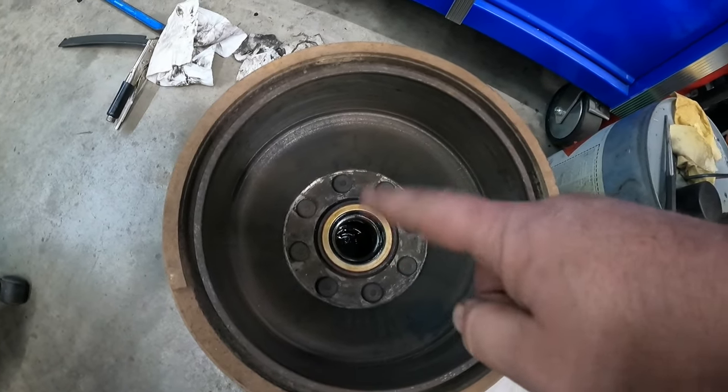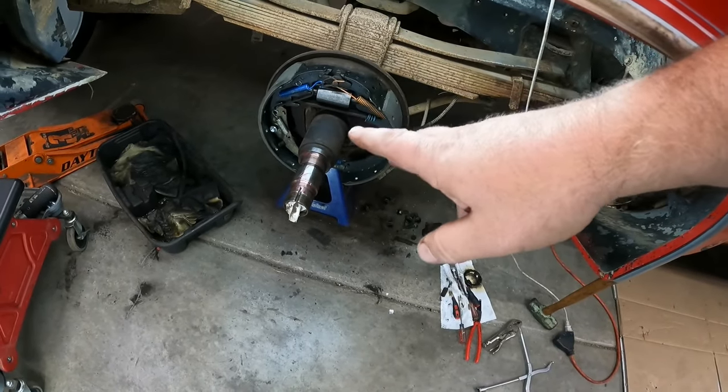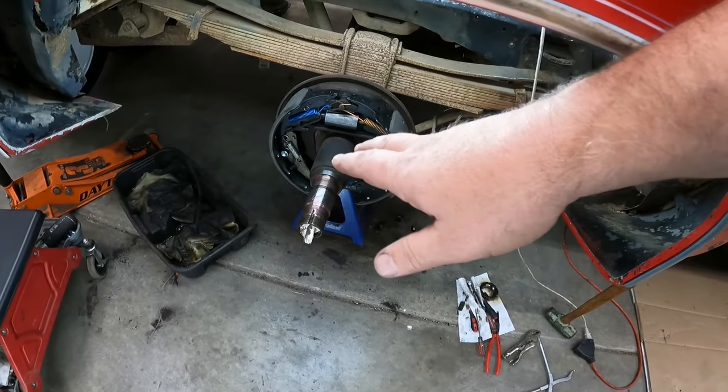New wheel seal's in. I just used a hammer and a two-by-four and walked around it, knocking it down gradually, because that thing is four inches wide and the two-by-four is only one-and-a-half by three-and-a-half - so I just walked around it and got it seated. I also slapped a little bit of grease on the axle - a very, very thin coat. I put a little bit of grease on the wheel seal rubber too, just so it doesn't grab and snag and ruin a brand new wheel seal. Now I'm going to go pick up this heavy son of a gun and see if we can't get her slid on there.